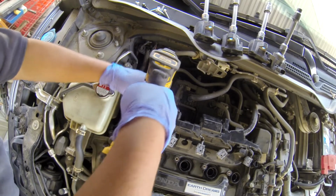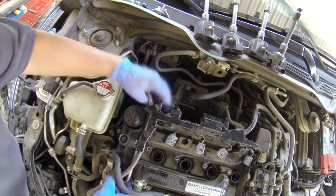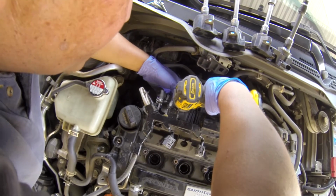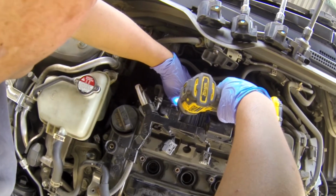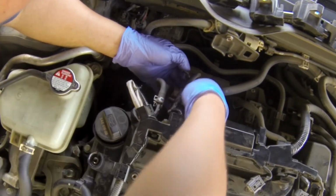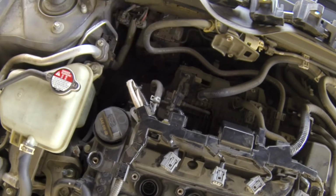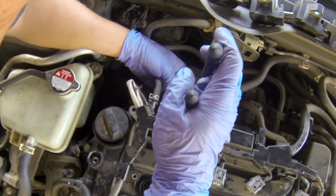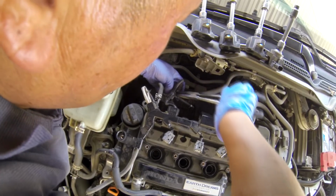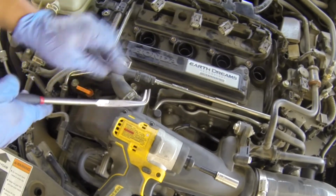Okay, taking down this bolt right here that's holding this line, so when detached from the back here, it will come off. I will detach the sensor, that bolt holding the sensor down here, and I will take down this little tiny hose connecting to the sensor. Let me show you that. See this right here, and disconnect this right here. This line, and disconnect from here.